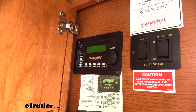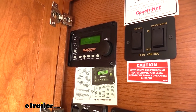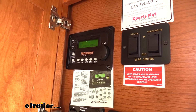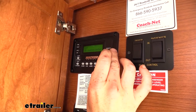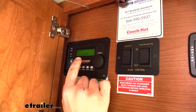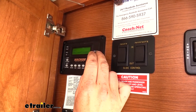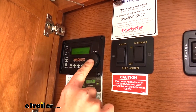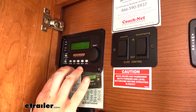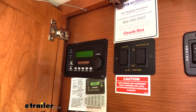Now that we've got the batteries hooked up, we do want to make sure that any of our chargers are set for the appropriate battery type we've installed. The batteries we previously removed were flooded batteries with caps on top, so we need to make sure our charger here is set to the correct strategy. You'll want to find the battery type on your charger and make sure it's set for AGM — if you have it set for a flooded battery, it could potentially overcharge your batteries and cause issues. If you have a solar controller, you'll also want to make those changes there, as this is typically a separate controller from your shore power charger.